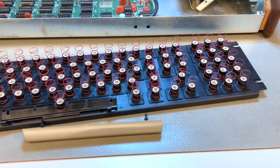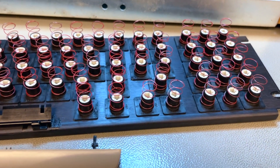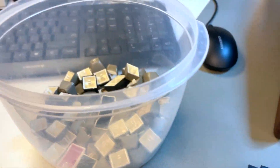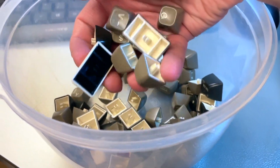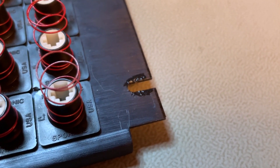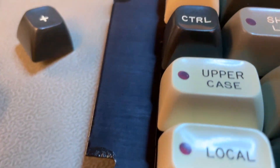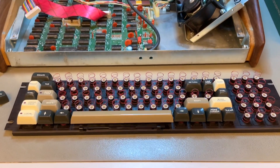So you get a clean base plate, and the springs are already all back. They are shiny because they are coated with a very thin layer of WD-40 — corrosion-free and protected for the future. There are three special springs that are harder for the keycaps with LEDs. The clean keycaps are already scrubbed on all five sides and dried. The metal parts where there were screws were damaged, scratched, and the paint came off, so I re-coated them with black primer. When I reinstall it I'm going to use black plastic washers to protect the metal and not let it get scratched again.